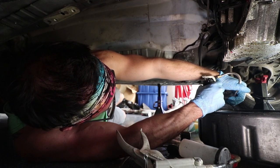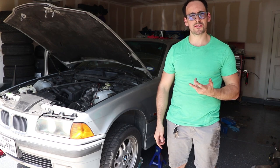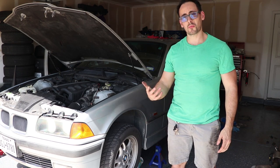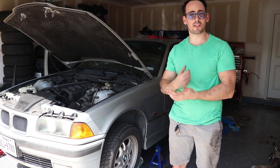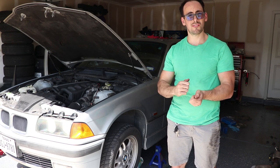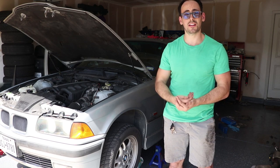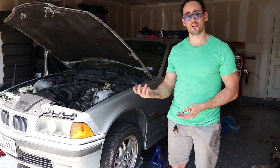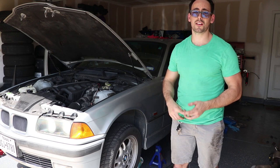That's how you change your master cylinder and slave cylinder and bleed the fluid. You may have a little bit of difficulty but eventually it'll get through. Normally what would make it easier is if it's bolted up to the transmission before you unhook your slave — pump the pedal a lot to get most of the fluid prepped, then do the basic procedure: squeeze, unlock, drain the fluid, lock, and repeat until you get pure fluid. You're going to need another person to help. I'll be able to finish mine once I get the transmission back in. Hope you guys enjoyed this video — hit that subscribe button and I'll see y'all in the next one.